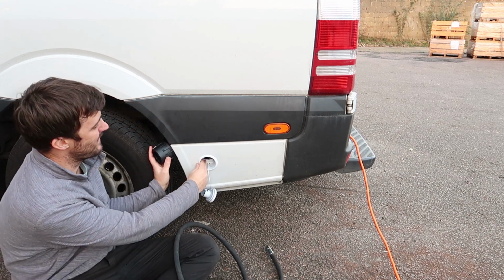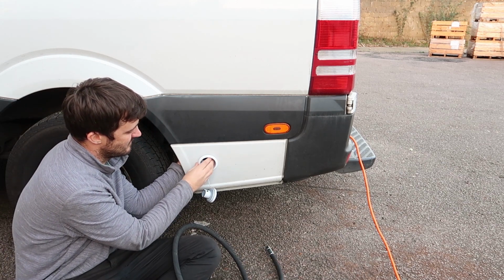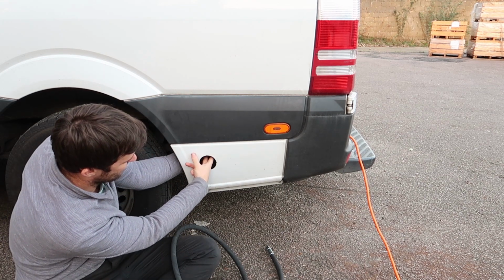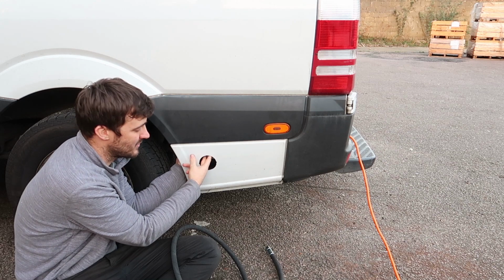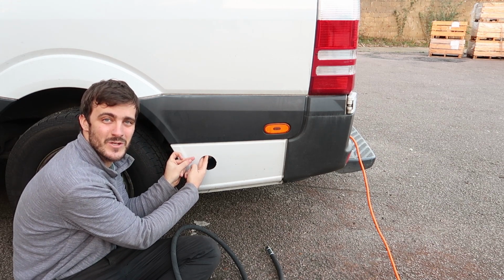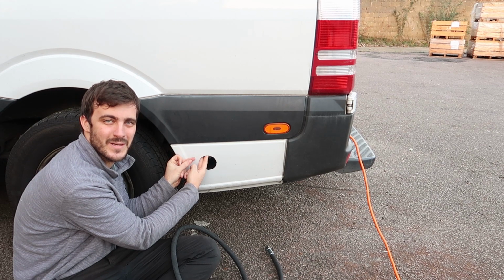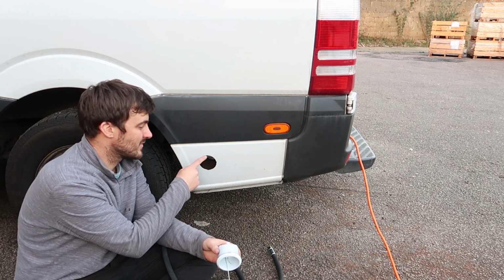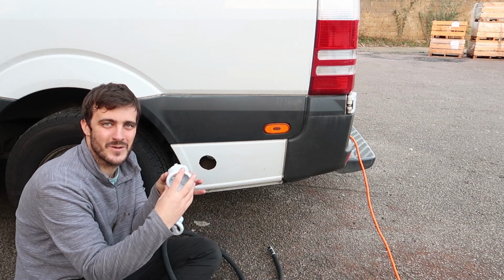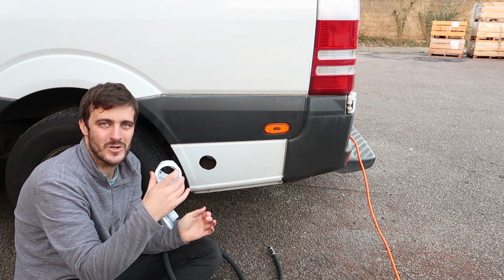And then we have a back cap which can fit through the back hole but can't fit through the front hole. This is what's going to sandwich together and hold everything in place. I did have to file two flat points at the top and bottom. These are for two little tabs here to stop the cap from being able to rotate.